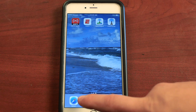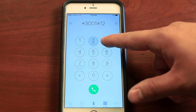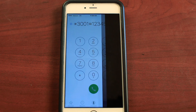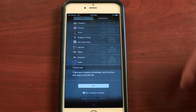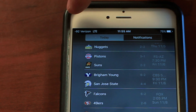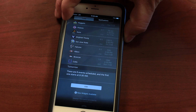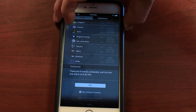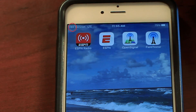To put your iPhone into test mode, go to the phone button and dial *3001#12345#* and press the call button. You'll see it comes up and says Field Test and there's some options below, but don't worry about those. Scroll down your notification bar and in the upper left hand corner of your phone where your bars used to be, you'll see the negative number right there — that's your signal strength. To make that number permanently show up, hold the power button for roughly five seconds and then hold the home button for another five seconds, and that negative number should always appear in the top left corner of your phone.